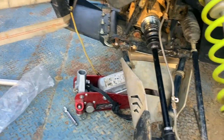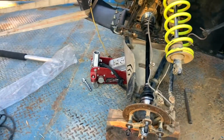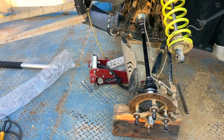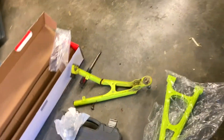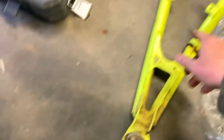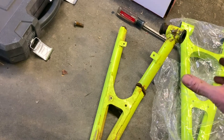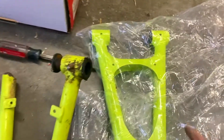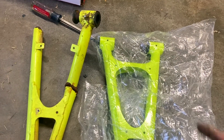I've got the axle shaft in, which took a lot of finagling. Now what I've got to do is go get the upper control arm — I've got to transfer all the stuff from the old smashed one to the new one. You can see the older one had no support right here, so when you hit something the two arms could spread apart and separate. Now I've got a brace across here, so I've got to switch over the grease fittings and all these bushings.